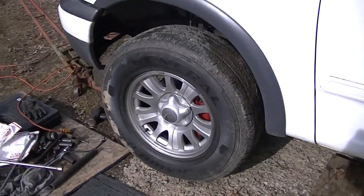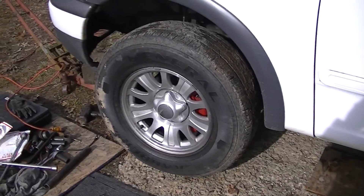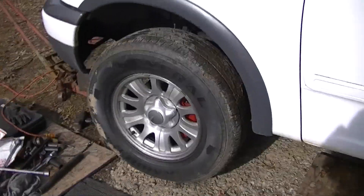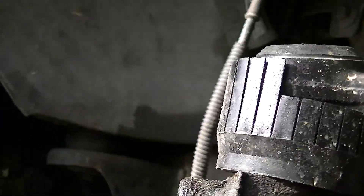Another day — it's beautiful out here in the 40s. We're going to do the driver's side. I'm not going to go through all the steps, but I'll give you an idea of what the ball joint looks like when I take it out and put it in. The wheel's off, it's up in the air, I've got my jacks for safety. The cotter key's out — go ahead and break this nut loose. Once this is out, all I have to do is separate that ball joint from the lower control arm and take the cotter key out of the top ball joint nut.